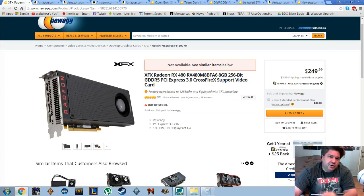It's overclocked to 1288MHz, just outside the turbo boost capability at 1266MHz, so it's not really that big of an overclock. Being that this one has WattMan on it, I've already tested it with the 16.7 drivers with power consumption turned off. We're going to turn it on and see if there are any frame rate differences in the future and I'll keep you posted. I don't want this video to be three hours long, so that's why I'm speaking quickly and going over the core components.